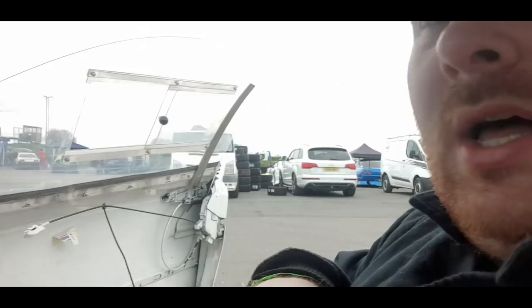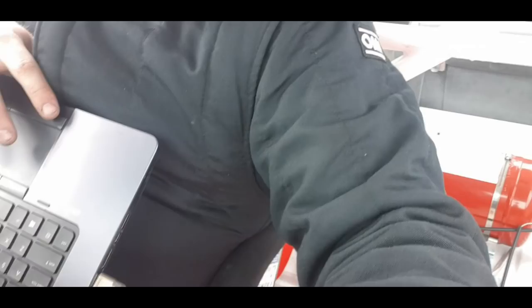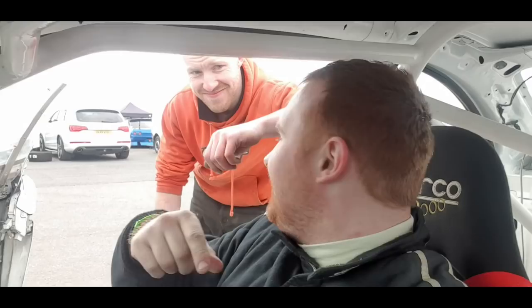I may have left a map on that I shouldn't have from Stubb's dyno the last time we were out, and I have to go back basically to the way it was last year. I was wondering why it was limiting out very early - we started dumping in fuel just to see what happened on the dyno and yeah, that doesn't work. So back to the way it was. I have the laptop here in front of me and I'll just throw back on the old map. Switch the ignition off, switch the key on to continue - boom. That's that done. Let's go and try this.